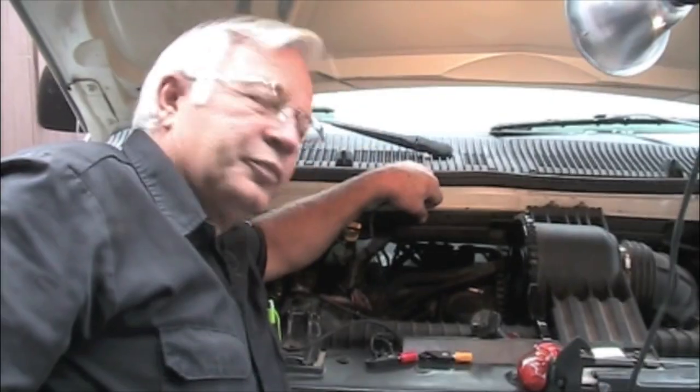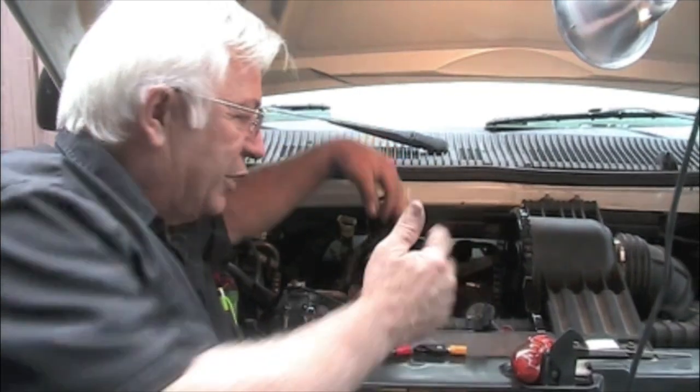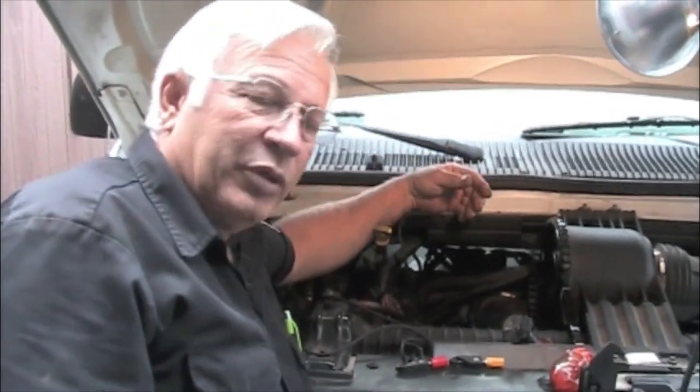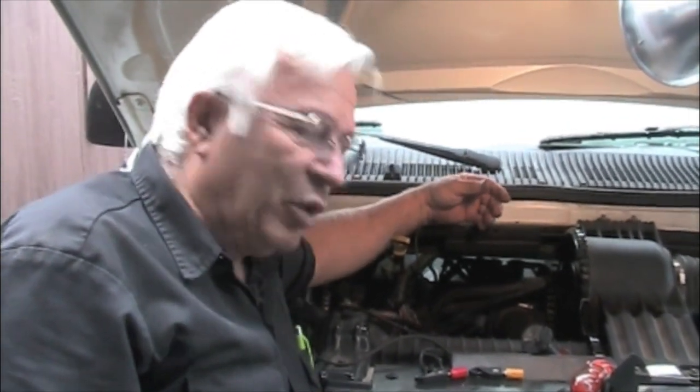So I'm going to pursue the fact that I've got a misfire and a lean code, and I'm suspecting I need to look at the injectors. This is a snub-nose engine, and the injectors are buried down there. If you're going to get to them, you basically have to pull the upper plenum off. Let's see how we can test this — I don't want to pull that plenum off unless I'm sure.